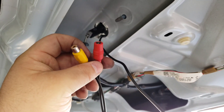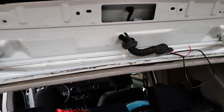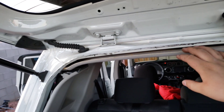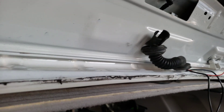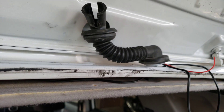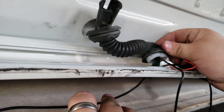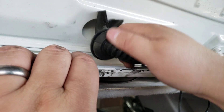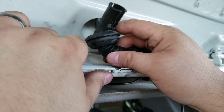Now you do have these wires — we're going to route these up. The longest cable that comes with the kit, you have to run that basically from right here in the hatch, all through the headliner and down however you choose. But one of the hardest things you're going to cross is right here. You have to finesse the RCA from underneath the headliner into this piece — you just pull up and it pops off.